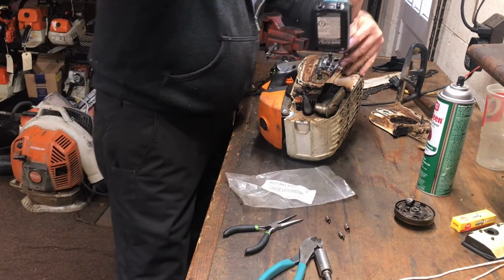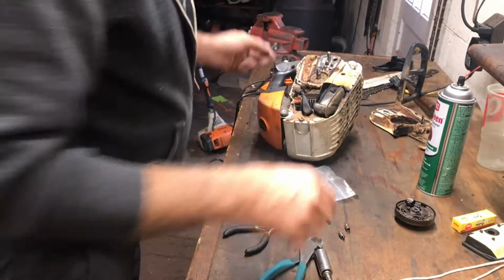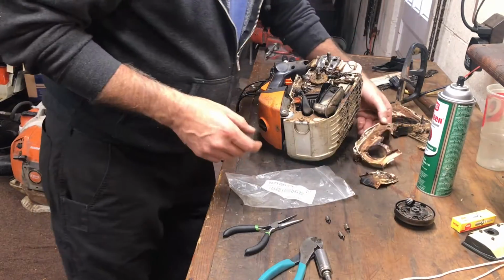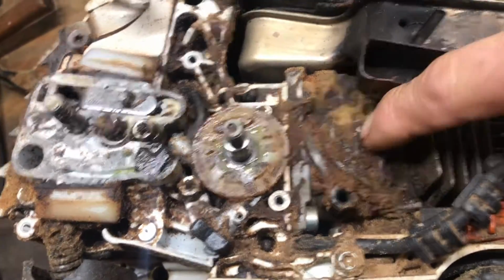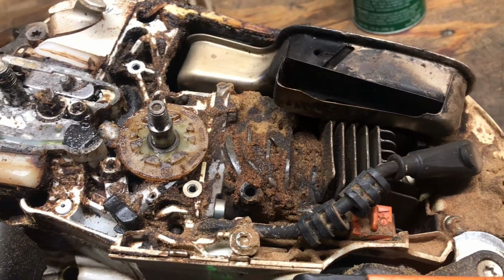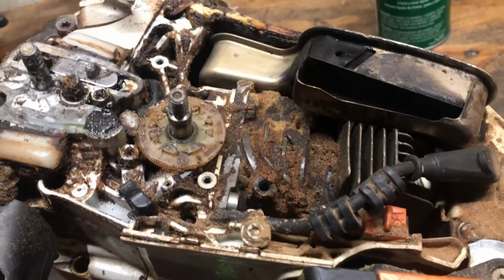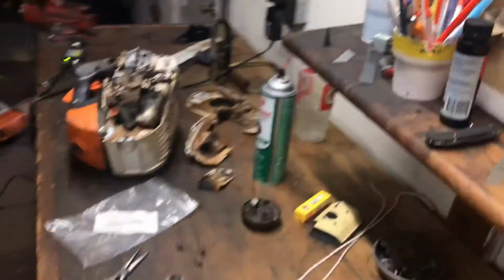While you've got your saw apart, I want to take this apart real quick and just show you. And this has nothing to do with the operator. It's just how these saws are. They catch all kinds of sawdust and they accumulate in here. So what you've got is all this oil and sawdust that's accumulated. This does not disperse heat. So I'm going to flip this over, take the recoil off, we'll inspect it, see if there's any wear in there, and we're going to blow this out really well and get all that oil and grease off the cylinder. You'll end up with false readings because the engine's holding so much temperature, and the auto tune will tune around that. You will lose performance, and excessive heat is never anything good.